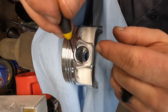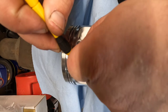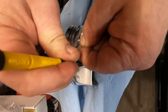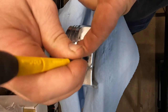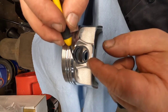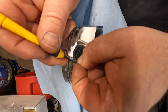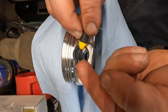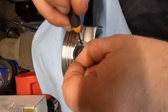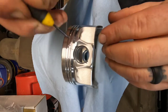Get it started. Do your best not to mar up your piston any. If we're working on this side, you want to try to pull the other side away to kind of stretch the ring around a little bit, but you don't want to horse it too much and stretch the ring out too bad. If you pull it the opposite direction that it's trying to go in, it'll almost just flop right in there. I'll make a note here too: on this piston, the pin boss goes into the lower ring land, the oil pack, and this tab can hang up on me. I've got to make sure that this end of the ring stays above that once I get to this point — if it gets hung down in there it won't push down. Get it above there, get it started. Once you get past that point, get it down in there, push it, and it snaps in.